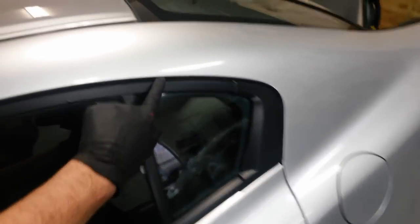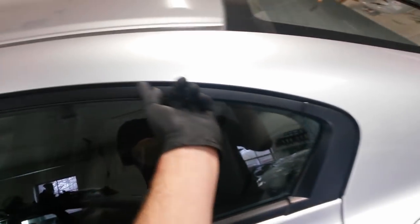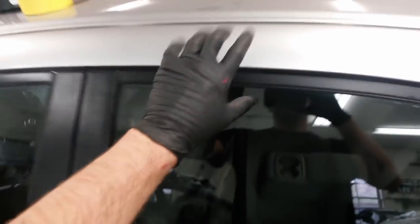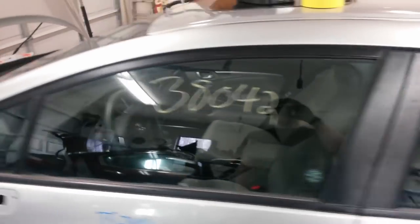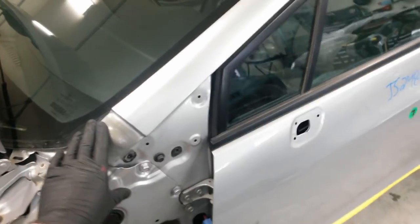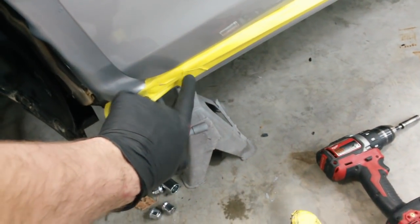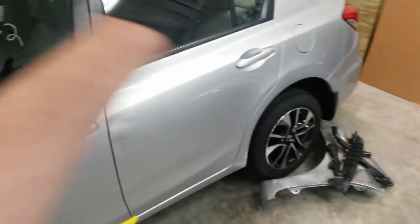side of the car, which I didn't really want to do because up here I'd have to pull the seals back, put some foam tape, sand in here. I don't really like leaving an edge there if I can help it. I'd rather just leave this alone because none of this got damaged up here. Since it came in from the side, it just pulled the fender away from this. And the front edge had probably some tire rubber or something on the rocker, but I wiped it off with thinner, so there's really no damage at all to the rocker, which runs all the way up.